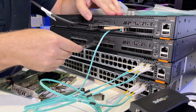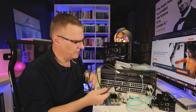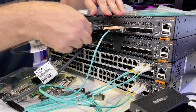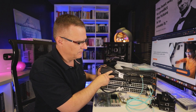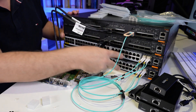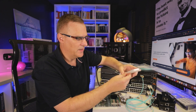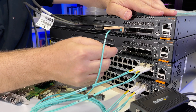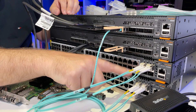I'll move this to make more space. 100 gig ethernet between those two switches — I've got a few of these. If I wanted to, I could connect multiple of these to give me 200 gig. If I bonded those two together, I could get 200 gig between these two switches, and 50 gig uplinks between the access switches to this core switch. Here's another 100 gig MPO cable. What you may want to do is connect it to this switch and then add additional connections to these two switches.